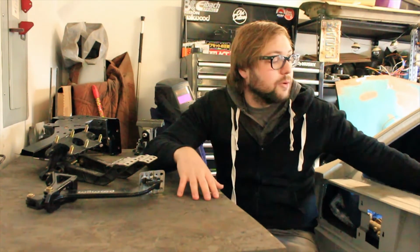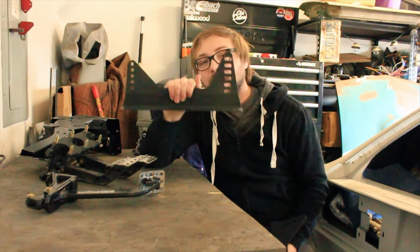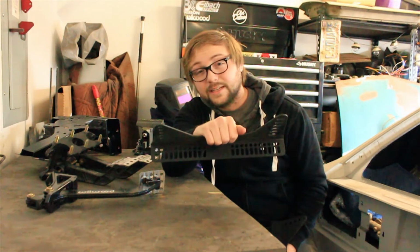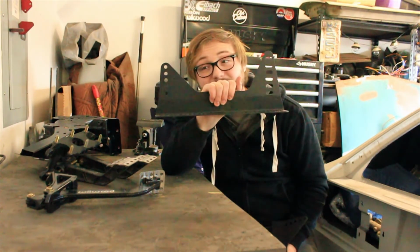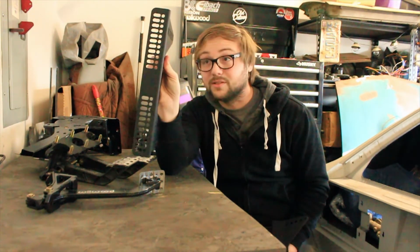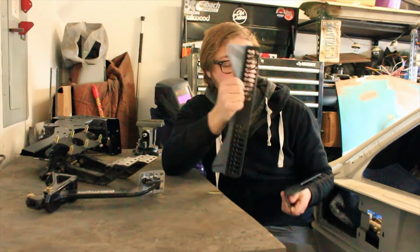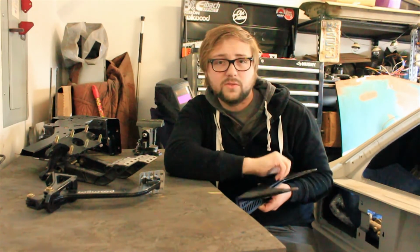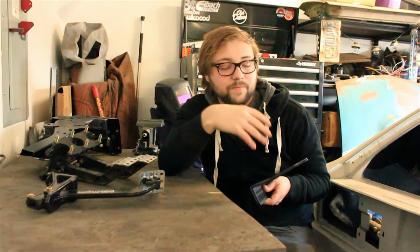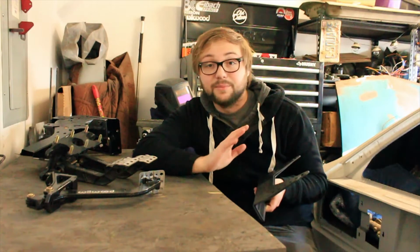And then to mount them, I'll be using just steel side rails. Now I opted for these just to get an idea for driver position, but given that I have to clear that kind of rear bulkhead is why I went with these, to make sure I get spacing high enough to clear it. The other thing I like is that in some way they are very adjustable. So for now, this is what I'll be doing. We'll probably switch to an aluminum setup for side rails in the future, but for now, just to get a basic idea, I just went with these. They're pretty cheap, found them off eBay, but I'll mount the seat and hopefully clear that completely.